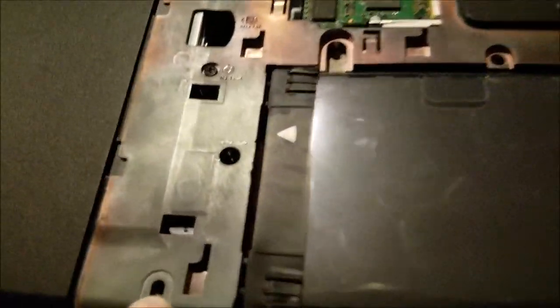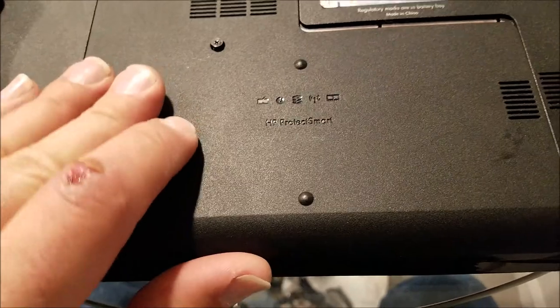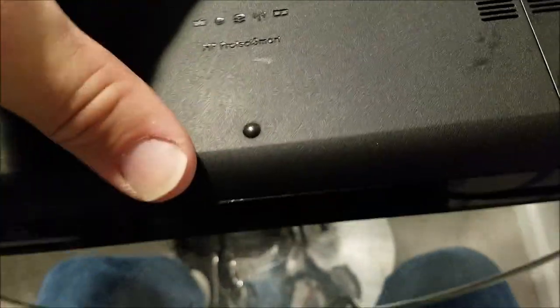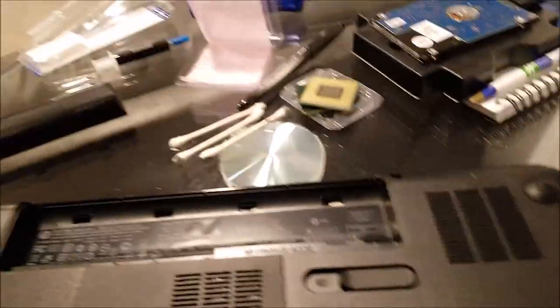Put these two on, then put my cover back on and put the rest of the housing screws on. See that little tab there — there are actually two of them — slip in there, fold down, push forward, and this captured screw. Threads down, put the rest of the screws outside. Alright, last thing left is the battery.